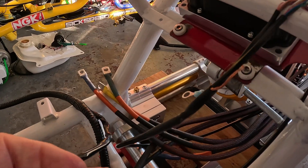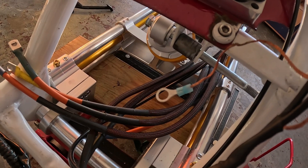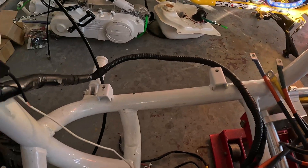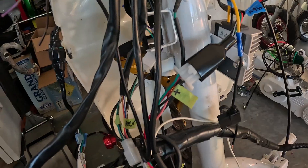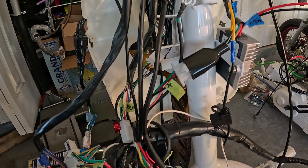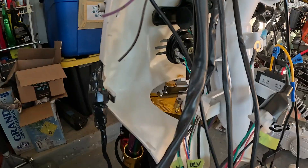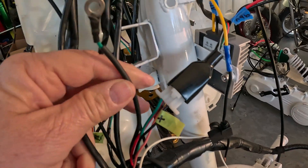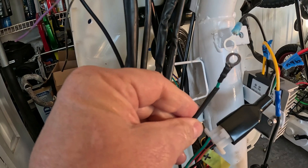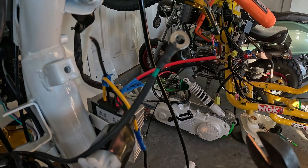On the ground side, we've got this big wire. Why do we have that big of a wire? That's also the ground for the starter. Typically on a car and a motorcycle, the starter is grounded by the motor — the stator shares the ground with the motor. But we don't need to ground this motor anymore, and if we don't need to ground the motor we don't need to ground the frame. Get rid of this whole idea of having a frame and motor as a common ground — that's a primitive idea for an e-bike. Pretend your frame is made of carbon fiber. Isolate this ground. We're only going to ground the headlights, horn, blinkers, tail lights — just this smaller ground wire, not the big one going to the battery.